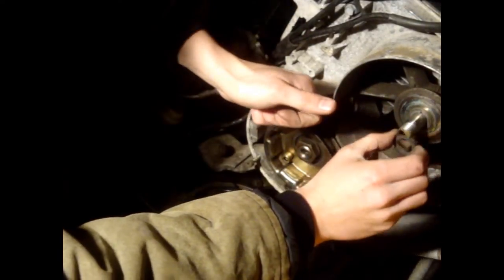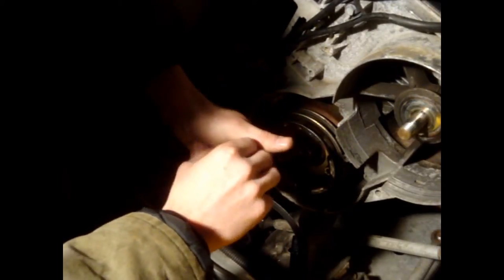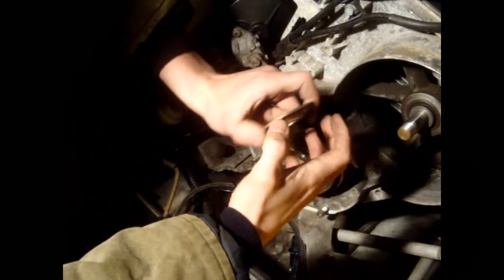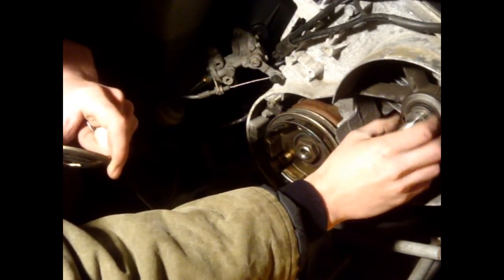So we come back to the fan, take off the nut and lock washer again, pull off the fan, and pull the belt back off — being careful of the keyway. We're going to pull off these spacers; I currently have 3 spacers from the factory. We pull the 3 spacers and the backing plate off, and behind there you'll find spare spacers you can add between the two sheaves of the pulley so the belt rides lower with less tension. I'm going to try adding the thicker spare spacer.